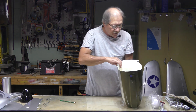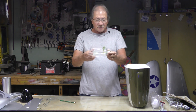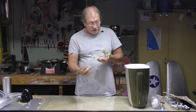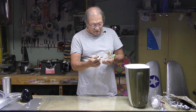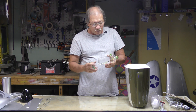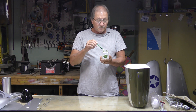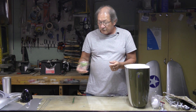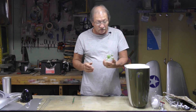The cowling comes stuffed with all your hardware, so I'm using it as a bucket. There's a nice tank — 500 cc — the cap is screwed on. Inside you can see fuel line tubing in the front with a piece of brass tubing in the middle, more fuel line, and a clunk. The clunk is pretty heavy so it flops down really well. On one side is the fill, the other side is the overflow, and all fittings are on there nice and tight. Pretty nice tank, much better setup than the original.